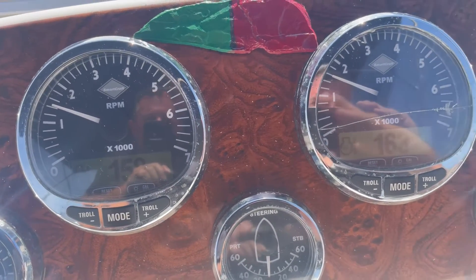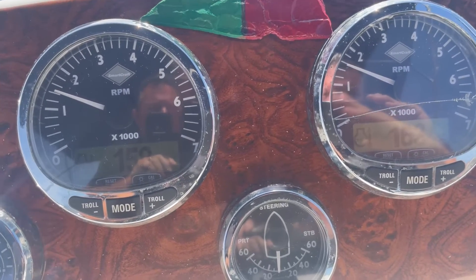The kit from Metal Art ETC does work — at least in the respect that it fits, it doesn't leak, and it definitely seals up the scoring. The jury's still out until I take it for a ride up on plane, but so far so good. If you have really bad scoring, don't spend seven or eight hundred dollars on a new pump housing — just pick up this kit and it should solve your issue. More to follow on this, thanks for following along.